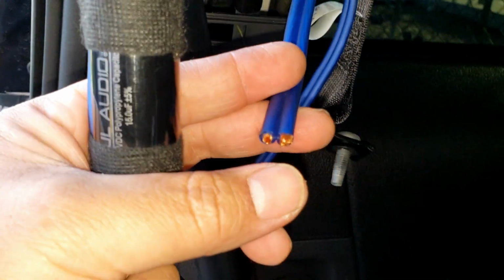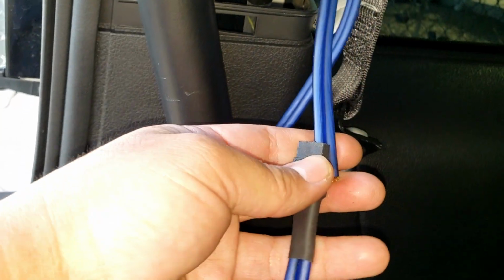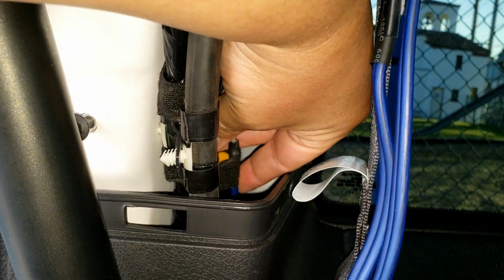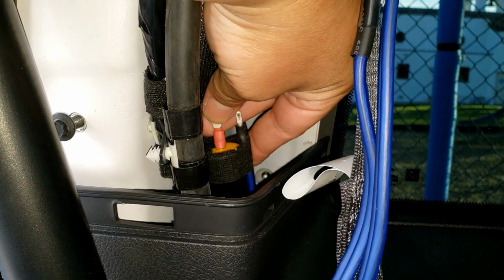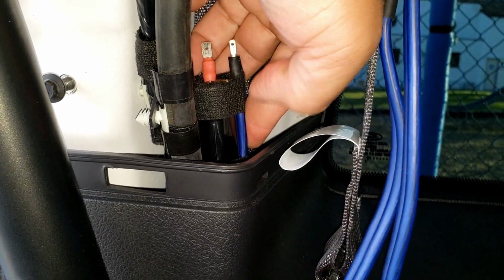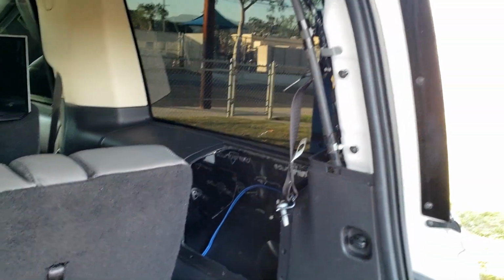So a quick disconnect is going to have to be soldered onto here. Then the quick disconnect on this end is going to connect to this one right here. And then I'm going to make sure that the wire is nicely tucked in somewhere where it's not going to be in the way. Then the tweeter wires can get connected to this end and it won't move out of place. They'll stay put. No matter what I do here, it will be connected with the zip tie in this area and it will stay put. And then I can go ahead and connect the tweeter to that. And the D pillar mid-range speaker will be direct because that will be controlled by the Tweak 88.